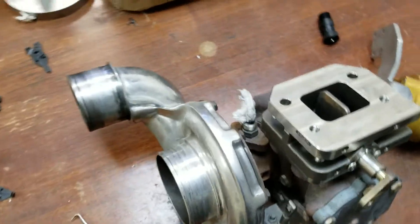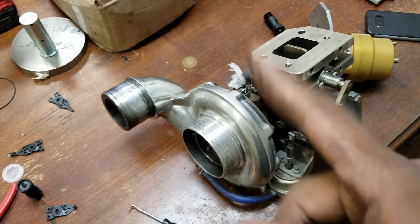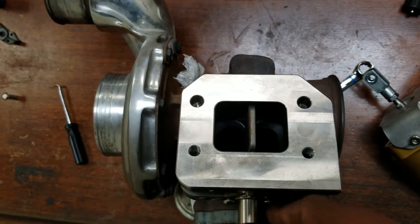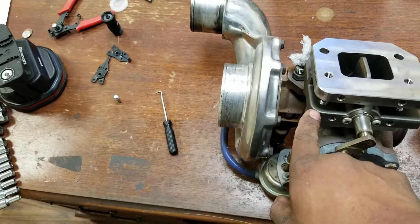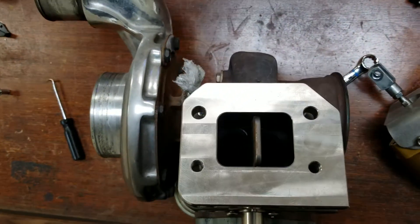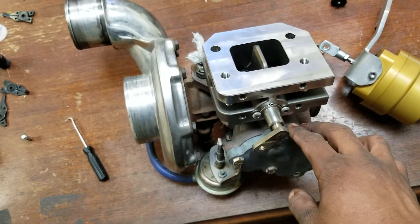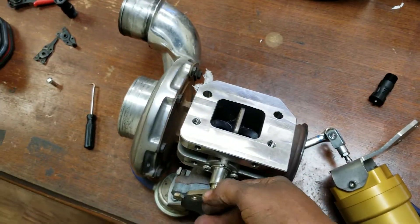This little beautiful monstrosity here is the 6280 Silver Bullet 300 frame turbo that goes in my truck, and I just got through making this work here. This right here is a T3 to T4 spool valve, and under that is a custom made spacer that allows me to hook it back to a T3 turbo, which is what this is. It's a factory replacement for the stock HE351CW turbocharger that came off of my 2005 Dodge Ram.